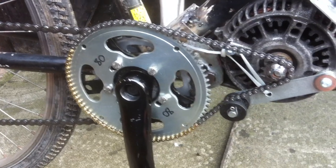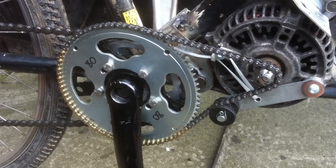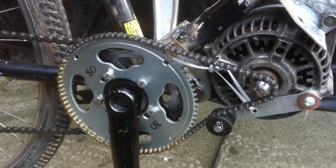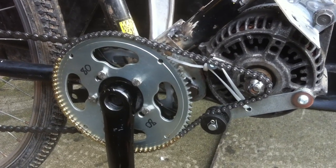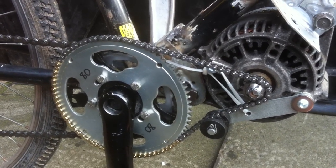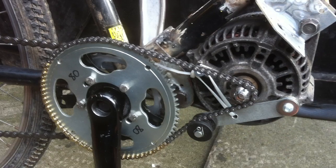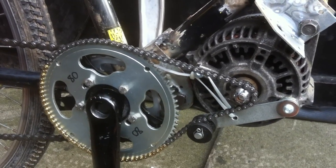It's a 25H 6mm chain, which is going to be marginal whether it's okay. But I've used one of these chains before on a converted hub motor which was running at 60 volts — it was a 250 watt 36 volt motor, but when it was upvolted you were probably pulling 900 watts. It had a 5-to-1 gear ratio with a 400 RPM output, and the chain coped with that, so hopefully it'll be okay here.